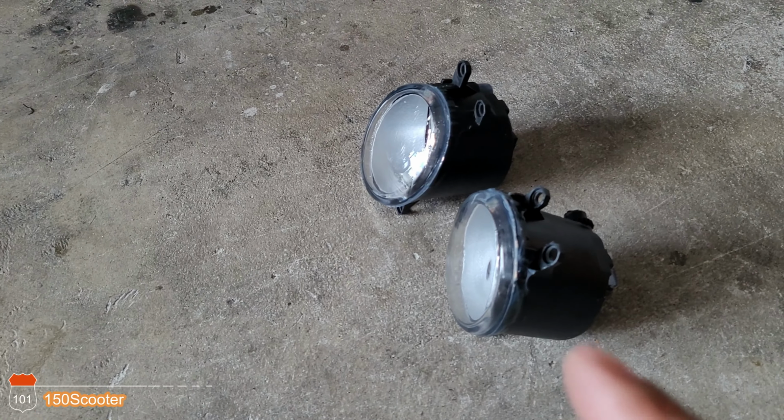And the next thing you want to do is remove this cover right here. The fake cover. Basically, the fake cover is right here. I open one side, all in the back is just a clip. And in order to install the fog light, what you want to do is you go from this side right here, right? So under here, there's a couple, I think 3 10 millimeter bolts. You just need to get them out.